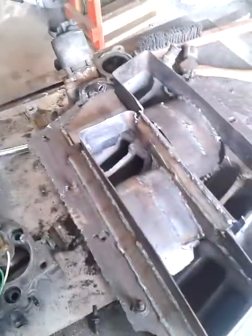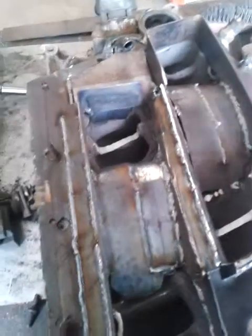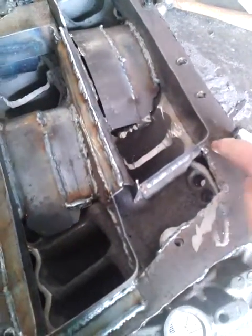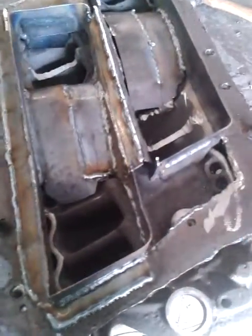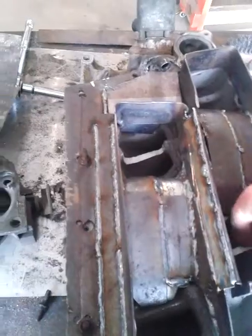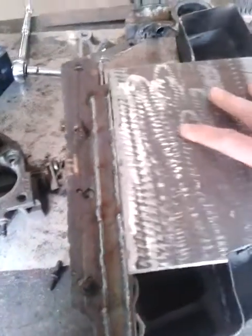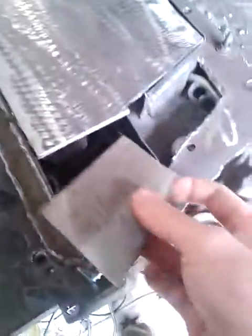If you guys have any ideas, let me know. These here aren't sealed yet — basically the sealing edge will be like how it originally is on the intake manifold, so I have to weld pieces in here to make it all airtight, and then all your vacuum will be going through these ports. I've got a big piece of heavy 3/16" steel here; this area will just be filled in with sheet metal because it just needs to be airtight.